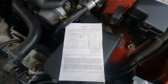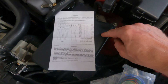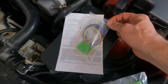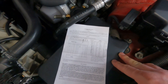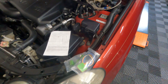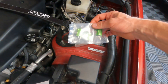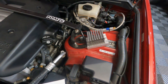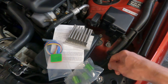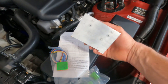It's going to get rid of all those codes and restore a bunch of power. Included in this kit are some wiring instructions, but you're going to need to do some research on your own. You're going to need to figure out the circuits on the ECM, which is under this box lid, and figure out what you've got to tap into. I'm going to show you for the GS400, but keep in mind the 430 and the 300 might be completely different as far as wiring goes. One more thing — a heat sink. You're going to want a heat sink to mount your resistors to, because those things get pretty hot.